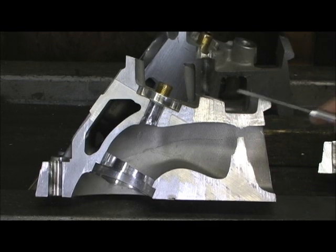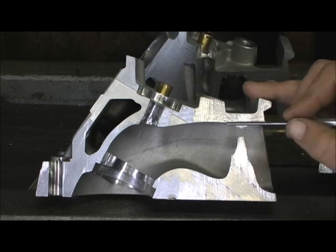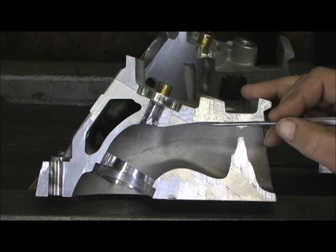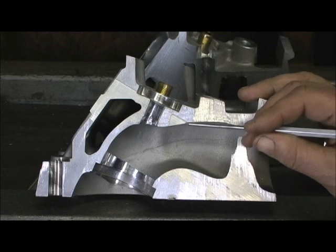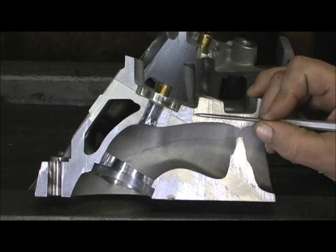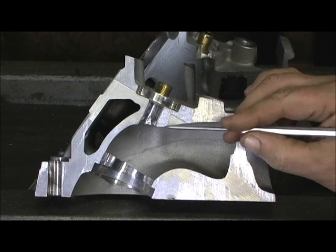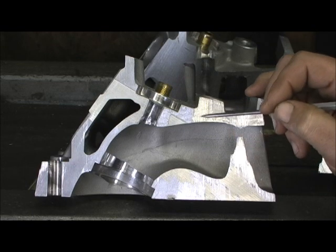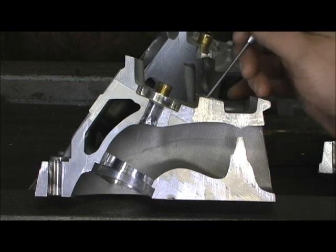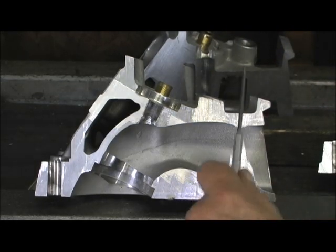But just in its current form right here, you've got ample room to go in here and cut. I'd probably begin to cut somewhere in here, go in there, and get my shape to match correspondingly with the floor, because that's what you want — you want to have that turn. They've given us a serious amount of meat right here to cut, which is modification at this point to about that point right there to form the hump inside of the head. And we've got a lot of thickness here for the stud support.